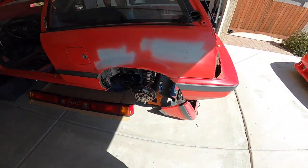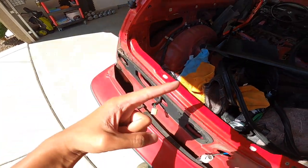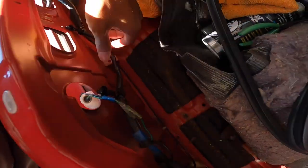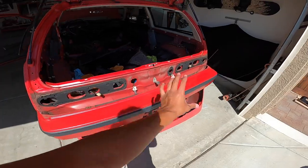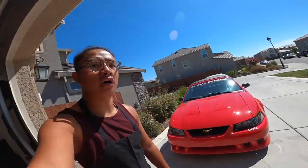...off the rear taillights. The taillights were actually quite simple to remove — there are studs on the inside of the taillight that go in, and there are a few nuts that hold those in place. It was just a matter of disconnecting the wires and unbolting those with an 8 millimeter, then I dumped them in a bag and tossed them aside. All I have to do now is pull off this trim and the car is ready for paint. I also need to put the battery back in, but after that, the car is ready for paint.